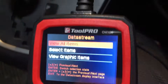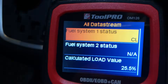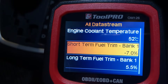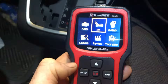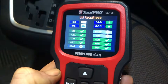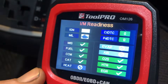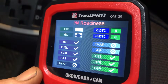Going back to those viewable items - you can see those numbers are actually changing, so you get some sense of what's going on with the petrol Skyactiv motor. What shows up here will depend on your car. For emissions measures you can access it through the menu or use the shortcut - it gives just a tick or a cross. Items like the heated catalyst that this car doesn't have will show a cross through them; an X would mean it's failed for some reason.